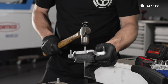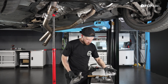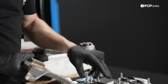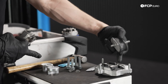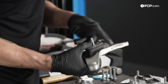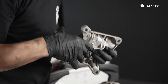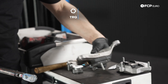It's not forced in there very much but you will have to give it a couple of good taps. We have our new mount bracket, our 034 street density transmission mount, and the factory mount that bolts up to the transmission. Before we start reassembly, take note that the longer side is the side going into the sub mount, and the shorter side is the side going up into the bracket. If you were to install the long one, that would more than likely hit the transmission before bottoming out the bolts. Pay very close attention that the short threads are going up towards the transmission upon installation. Snug that down and then torque that to 20 Newton meters.